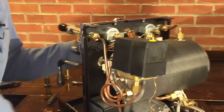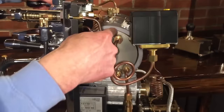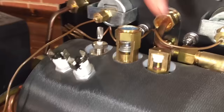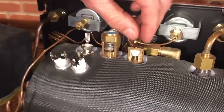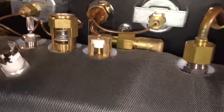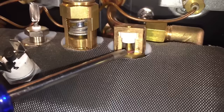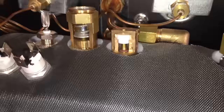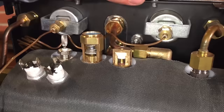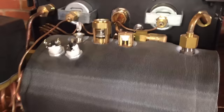The pressure stat takes the pressure off the top of the boiler, up into here, and that's what turns on the heating element — controls the heat. On top of the boiler we've got two little gizmos: a vacuum relief valve and a pressure relief valve, also known as a safety. In the vacuum relief valve, you see that rubber O-ring — it goes up and seals against this Teflon. Sometimes before the machine heats up you hear a little hissing inside for a moment — that's before that valve closes. Its purpose is to open it to the atmosphere so the water can boil off and heat up. Without it, you can get a vacuum, and if you go to steam milk it could suck milk up your steam wand into the boiler, which is a real mess. The steam will come blasting through there and when it picks up enough velocity, it'll close that valve.